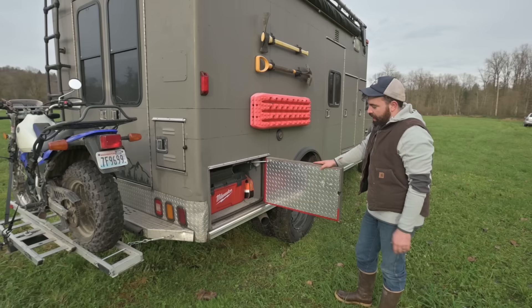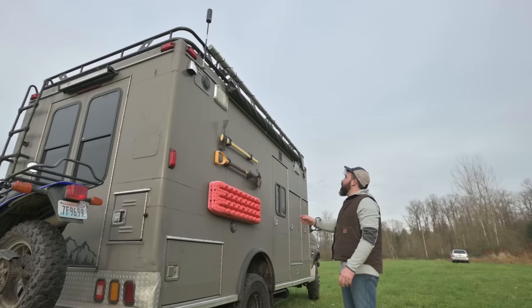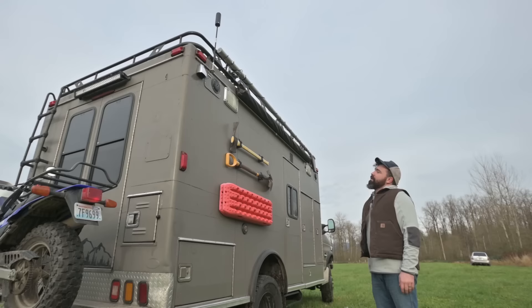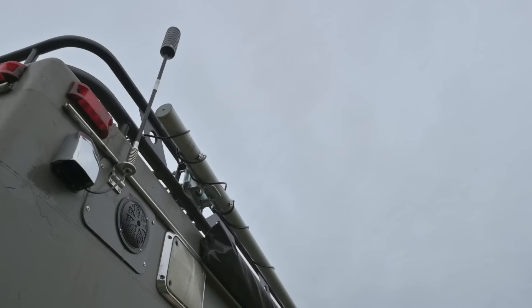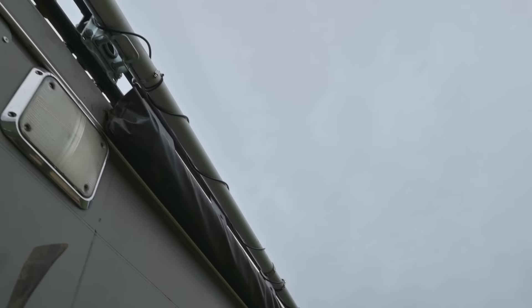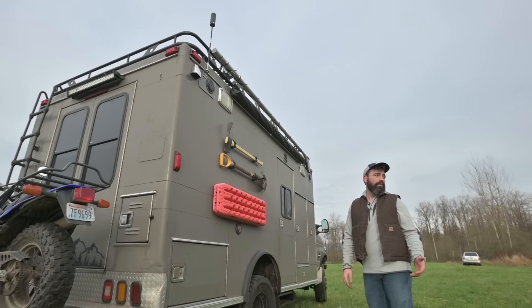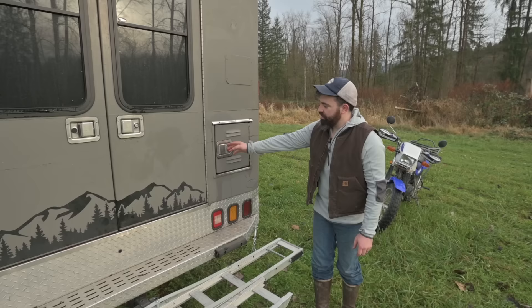This is our toolbox. Inside we keep our recovery straps, our clevises, a bottle jack, fix-a-flat — all the stuff we need to repair the inside and outside. We have an awning on this side that unzips with legs that fold out. Right beside it and above are our cellular antennas made by WeBoost — one omnidirectional and one directional on a long pole on the side. 95% of the time, the omnidirectional gets us all the service we need, but if we're way out in the boonies — particularly in Colorado and Arizona — we flip the directional antenna up, raise the mast about 25 feet, and get line of sight on a cellular tower so we can still work and have internet.